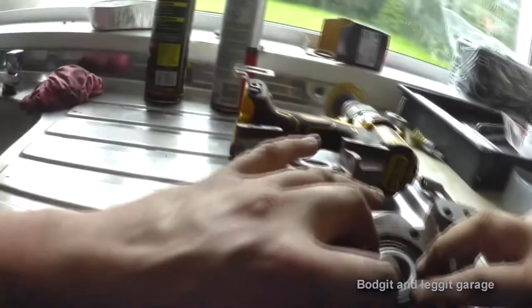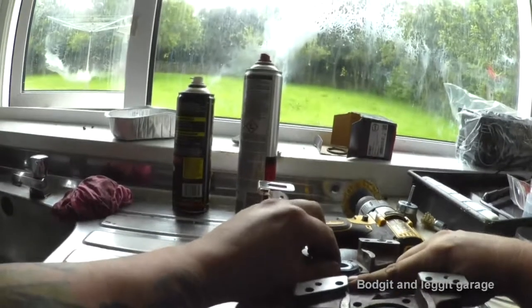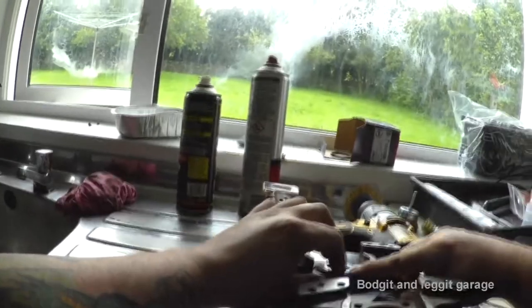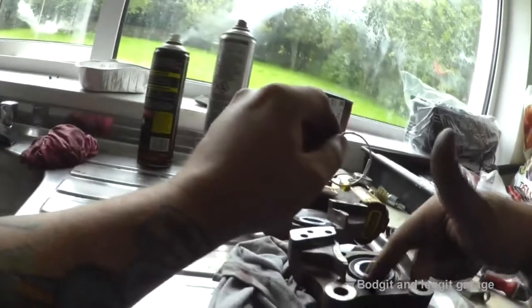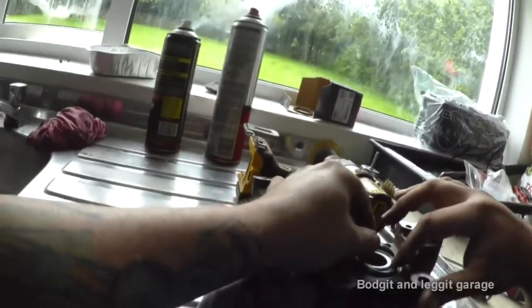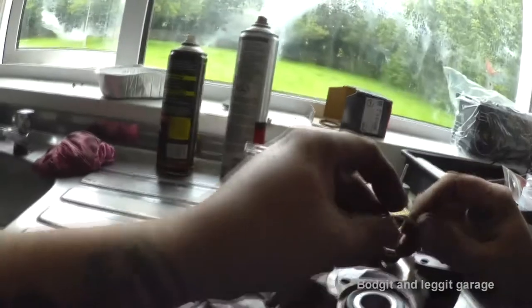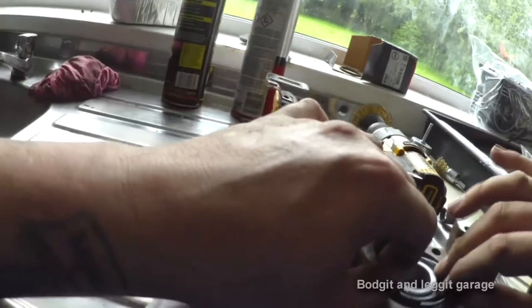I have an idea but I don't know if it's going to work. The reason the original seal worked is because there are two seals connected — the top seal lifts up while the bottom seal stays. With this replacement seal it's just one seal with no lip or groove in the caliper for a circlip to lock it into, so it just slides up with the piston. There's no lip there for that clip to sit in, where on the other side it's perfect — not a problem.